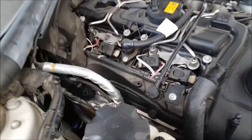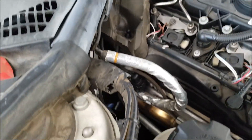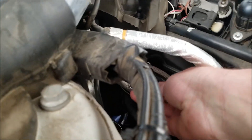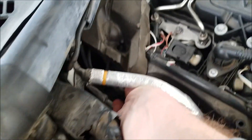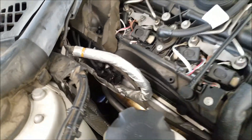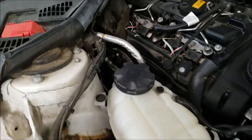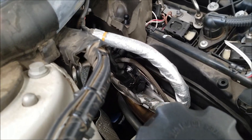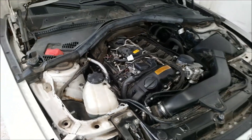The way I diagnose this is just by unplugging the old part like this — and the noise stops. I just push that little wire pin inward toward the plug and pulled the plug straight up. So it's definitely that part that's having the problem.